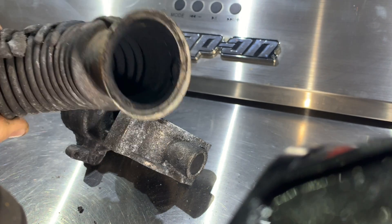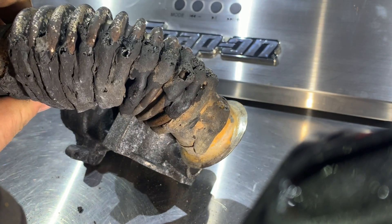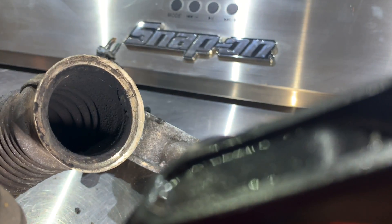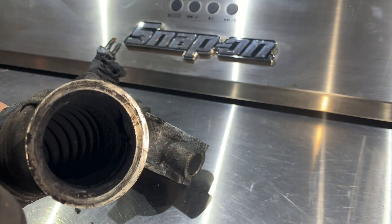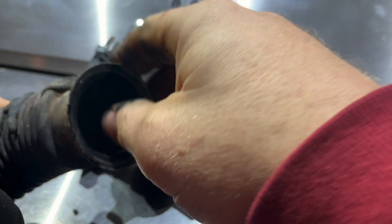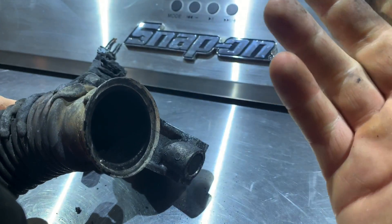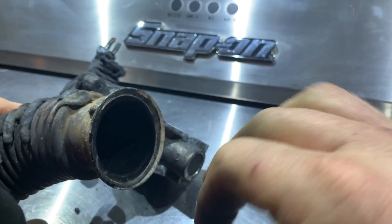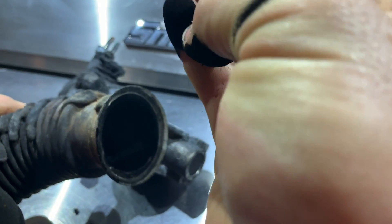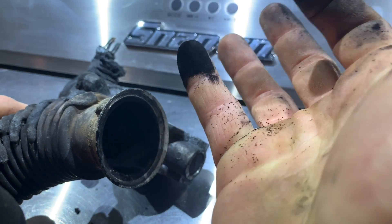This one did not have a failure — it had some external damage, and we don't want to use that pipe, that's why the new one was replaced. So we want to make sure we have good carbon in our EGR. That is absolutely normal. The machine's got probably close to 3,000 hours on it at this point, so this is really a good setup for what we have in EGR. I'm going to stick a finger in there and show you — it flakes off, you can see it falling down, it's not slimy. That's good EGR right there.